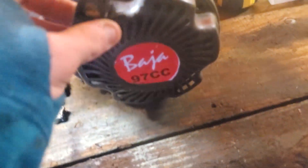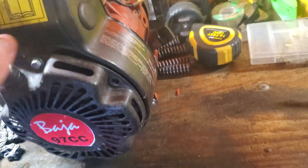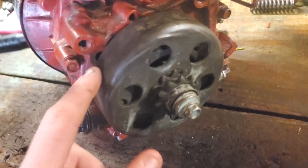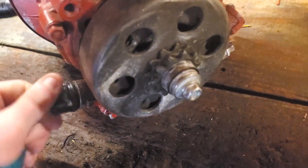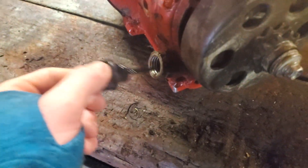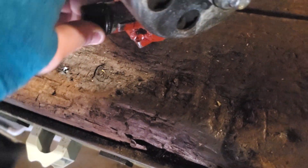So here is the old motor. The bike is actually an 07 model, so it's about 13 to 15 years old now. This motor is rated at 2.8 horsepower, supposedly. It's broken because the entire rod that holds the carburetor in place is broken, so I'll have to do some weird welding. The pull string still works, and I painted the engine enamel red on the bottom, but it's kind of dusty. The clutch is okay but feels kind of shot. This motor is just so small and weak — it'd be good for putting on a scooter or something, but it doesn't cut it for a bike.